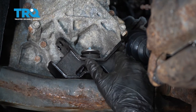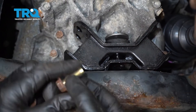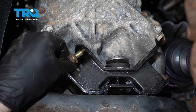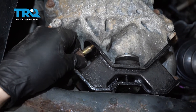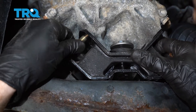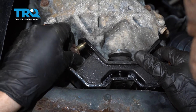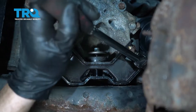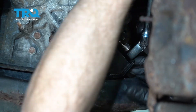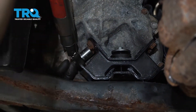Okay, that's pretty close — I can still move this a little bit. Let's grab our four bolts and start them in. Make sure the thread of all your bolts is nice and clean. For these, you don't necessarily need to use any thread locker or copper never-seize. Bring up the transmission a little bit, try to get this so it's lined up. We want to be very careful not to cross-thread any of these in. Now that we have them all started, let's just bottom them all out. Once they're all bottomed out, go ahead and torque them to 47 foot-pounds.